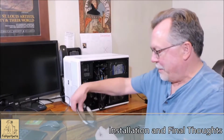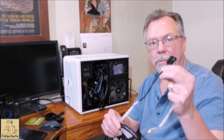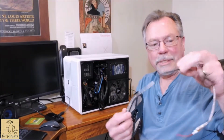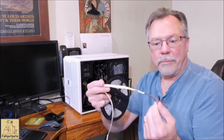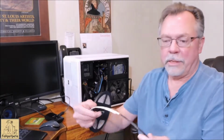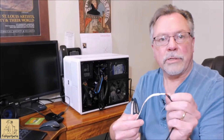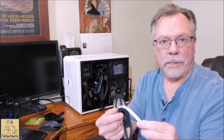Okay, we're back from the shop, and I went ahead and soldered up my Molex connector to a fresh reel of lights. Because it already had a hardwired connector, I thought I'd just utilize that. If you remember from the previous shot, I showed you how they look when they first come out of the box, and they have these long leads like this. I just cut it down a tad and put some shrink wrap over it just to keep it black like the rest of the interior. I did leave a little bit of that red and black wire showing so it'll give me a little more flexibility. The white on that shouldn't really be visible for where I'm going to put this anyway, I hope.